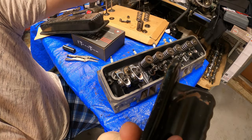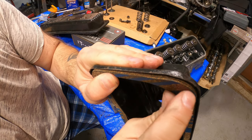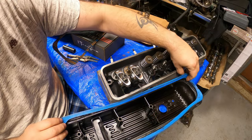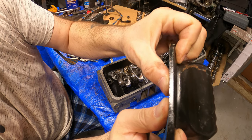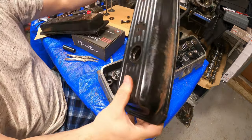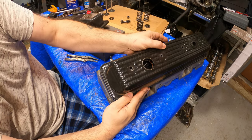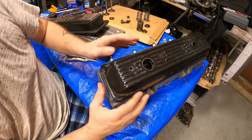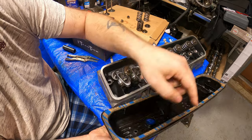Let's see if we can get a clip of that. See how it comes up over the ridge here compared to the stock gasket — this is a super simple solution instead of buying pricey aftermarket valve covers. See how thin the stock one is? Now we're going to silicone this — I'm just pre-test fitting everything here. Boom, look at that — it sits beautifully and it's not going to interfere with the F-body alternator, because it just brings the valve cover up just a tiny bit to get that extra clearance. Now the rocker arm clears with the tin-snipped brace and the added clearance of the thicker gasket.